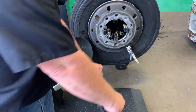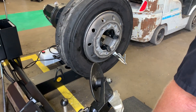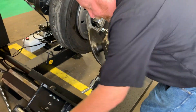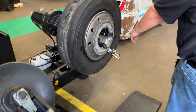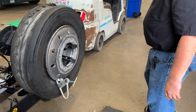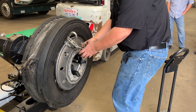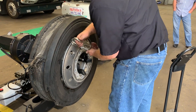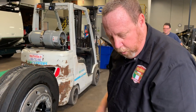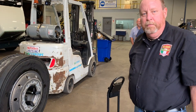Bring your tool arm assembly out to the right. Go ahead and put your tool arm assembly up to the next guy. Don't bend down and pick that up — that's too much work. We want to work smarter, not harder. Bring the clamp up until 11, 12 o'clock and remove it, and then hang it on your tool caddy or up on the wall, wherever it belongs. That's the Service Pro 426. Thank you very much.